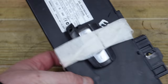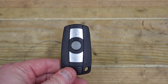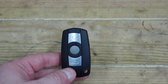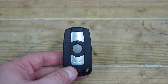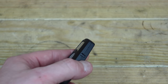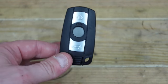This is the CAS module — the security module that BMW uses. You'll find it's located under the driver's side, running from the starter lock down underneath the panel where your steering wheel is. The next issue is a blocked key. I get a lot of people buying keys off eBay thinking they're going to work with their car. If the key has been blocked by BMW, only specialists can unblock that key via the CAS module — you need special software and a programmer to unblock or re-enable the key, or swipe the key to make it blank again. You can also buy a car with two keys where the owner doesn't know that one of them has actually been blocked.